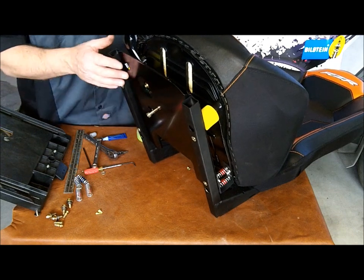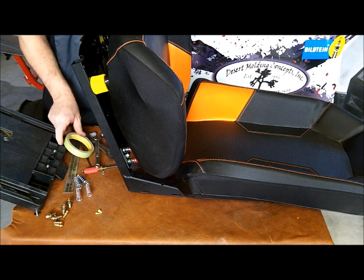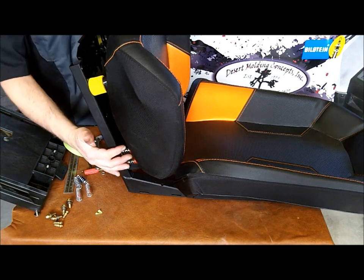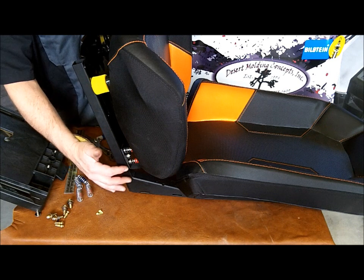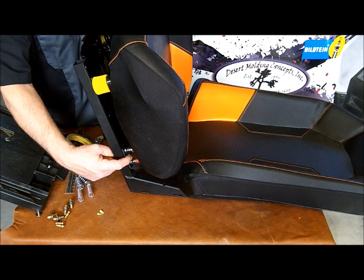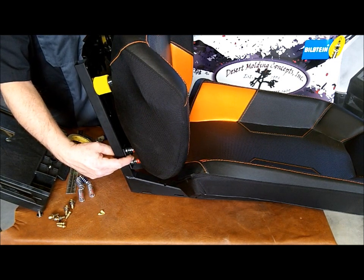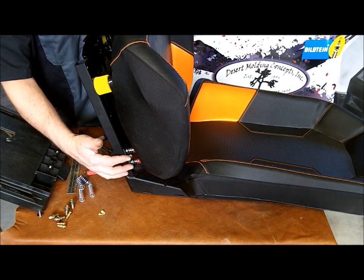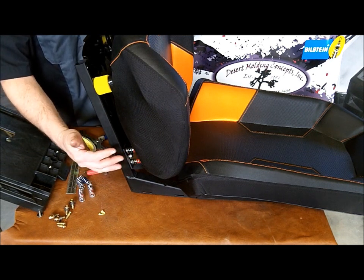We're going to want to install the main spring. Now, of course, this is a 3-spring setup per side, and there's several different adjustments you can make for rider weight and ride on the SSB. You'll always want to run a spring on the center mounting point, which is the center load of the bracket, and then you can use a combination of any springs to get the ride height or the ride that you want.